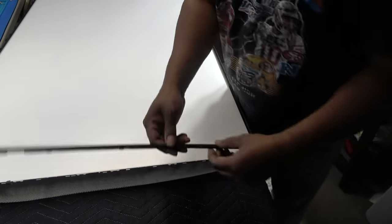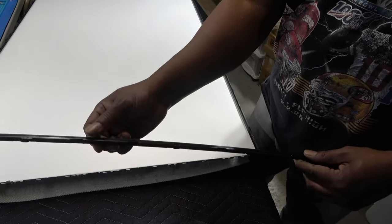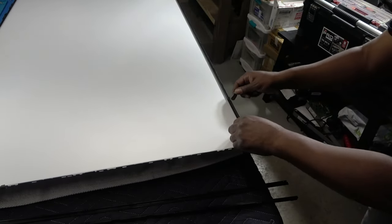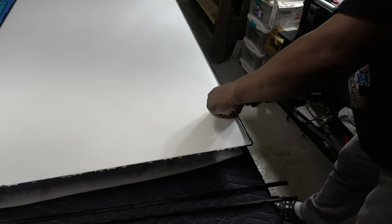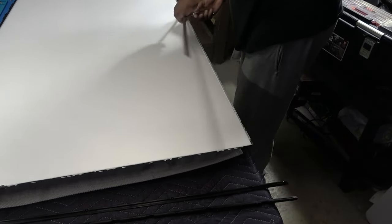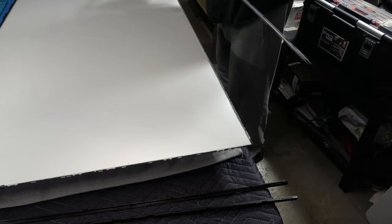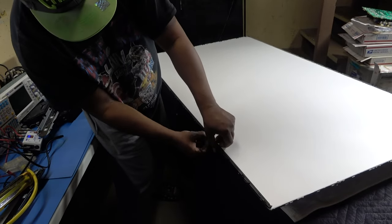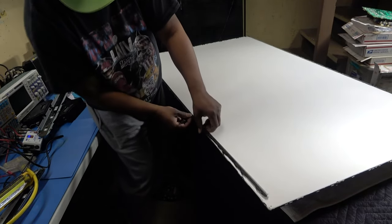Because you wanna make sure these are exactly flush when you put the screen back on, and then put back on the outer bezel, because if one part is sticking up or it's crooked, you're going to crack the screen once you put it on the outer bezel. Okay, just stick it in here like that. For indentations, lift it up. That's it. Okay, do the bottom piece. You can use your fingernails, that's pretty easy. These little tabs right here clip right off.